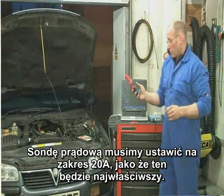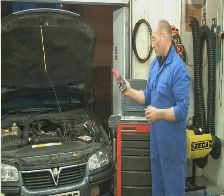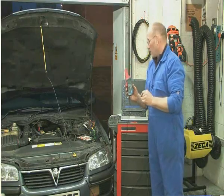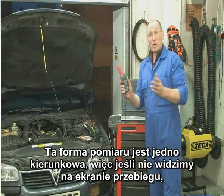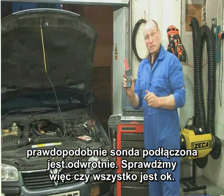We need to switch the inductive current clamp on. The 20-amp range is the appropriate one, and we may have to zero the tool later on. This clamp is directional, so if you get no trace, then it's upside down — we'll see how we go.